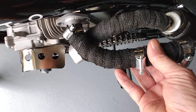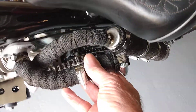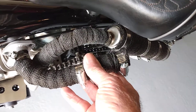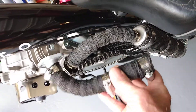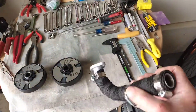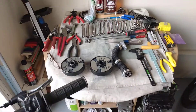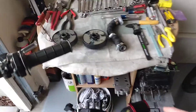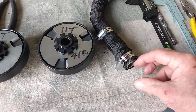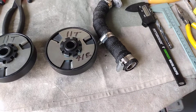The heat wrap worked. Now the problem is I had one of those little cheap cone Briggs & Stratton style mufflers on here. The problem with those $4, $5, $6 cone mufflers is they don't hold up to vibrations — they shear off right where the nipple goes into the pipe and then the cone just breaks right there.